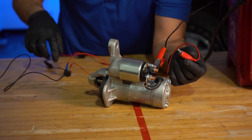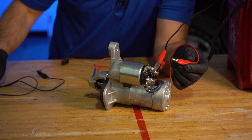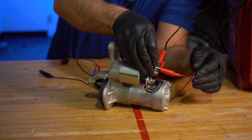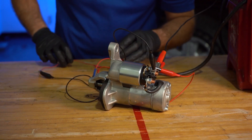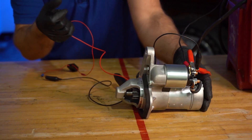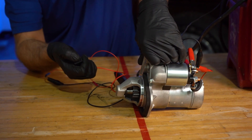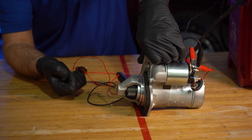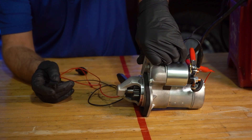Now I have a jumper wire — it goes through a switch and there is a fuse there just for safety. I'll put this on here and this is gonna go to the switch here. So, as if you were turning the key to turn the starter on, that's what the button emulates. As I push the button, you'll see it move. You see the gear pops out, and then it goes back in once you release the switch. And that's how a starter motor is supposed to work properly.